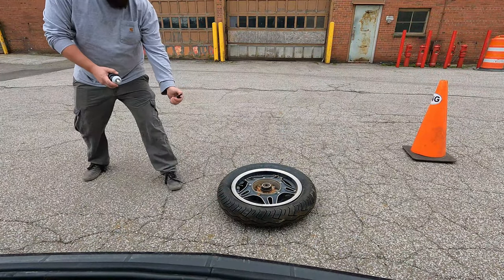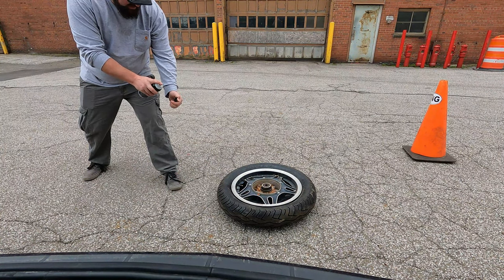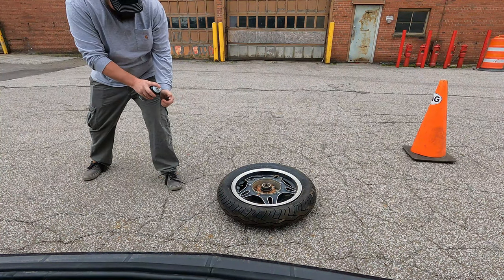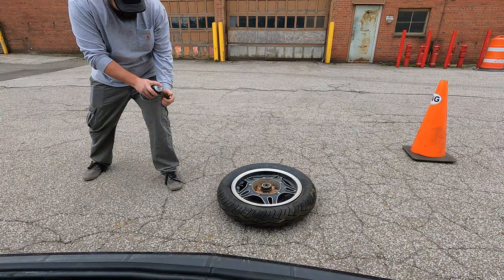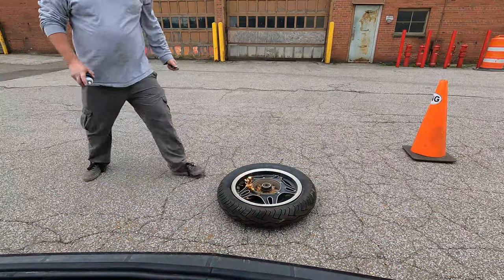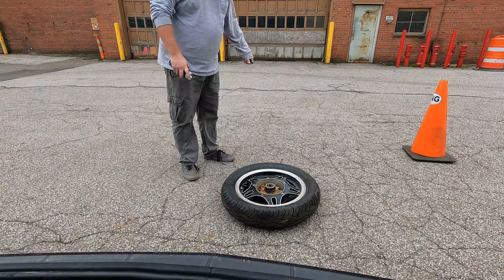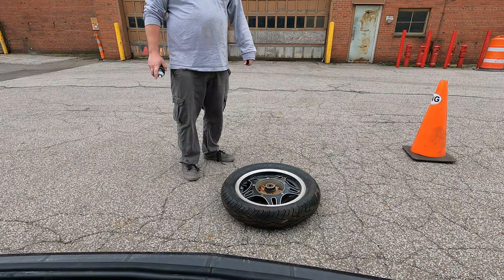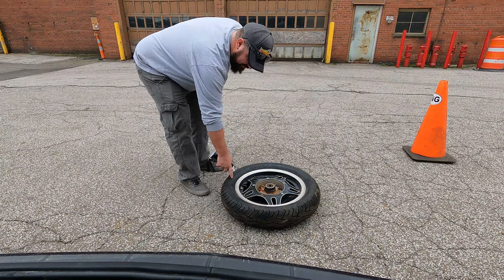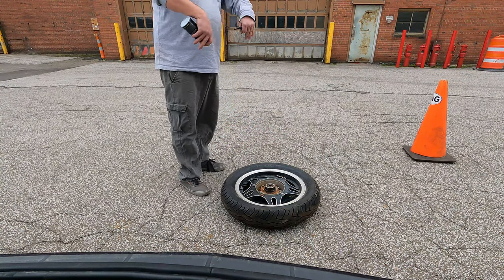Now take your lighter and light it. It's windy out here — come on, damn it. There you have it. Tire's mounted up on the bead. I had to give a little boost with my foot because initially just the puddle out here lit on fire. Then when I kicked it with my foot, the tire mounted up onto the bead because the fire went down inside of there.